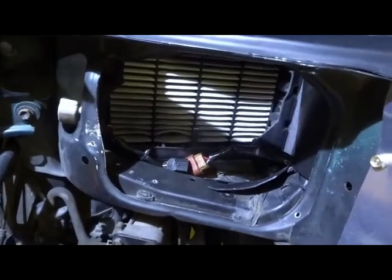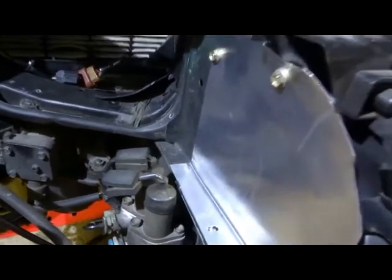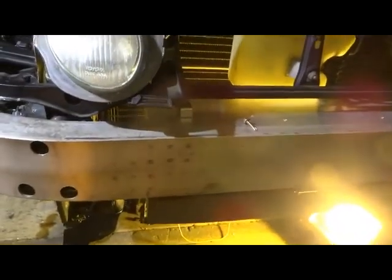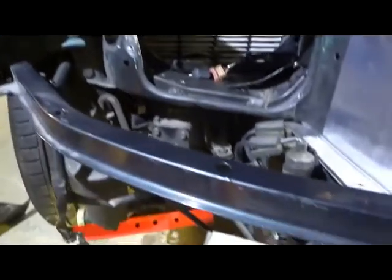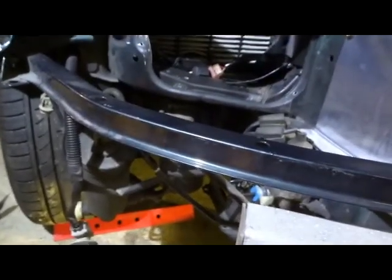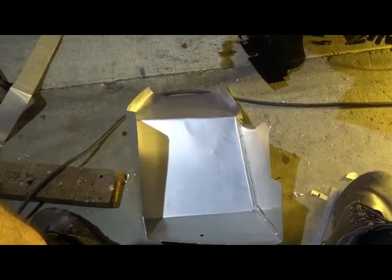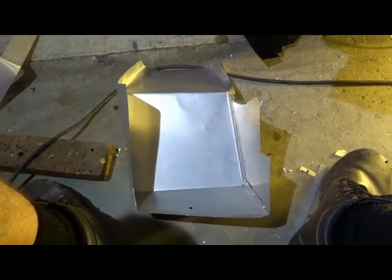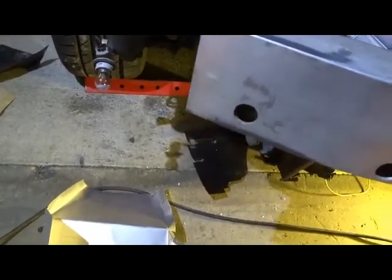I've got the big air filter modification. Originally the air used to come up from in front through the ducting at the front, in through the side there, which now, because of the intercooler, is taking up most of that area, so it's only going to be hot air, and there's not enough room. So I basically opened this up, and I'm going to go down on the left hand side where the intakes are for the brakes, and the cooling inside there. So I've made up an aluminium box which I'll fit up now, and then the front bumper, etc., all goes on, and that just slides up into it, and so it breathes in underneath, comes in underneath here and up in through here.